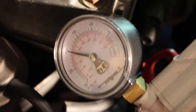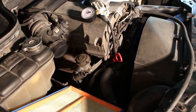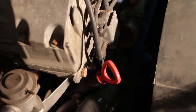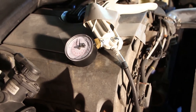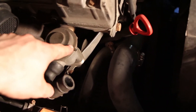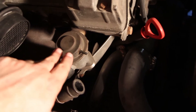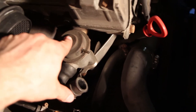As you can see, the secondary air injection check valve — or vacuum solenoid — is holding vacuum at 20 inches, which is about how much vacuum the engine would give. So that's good. The new test setup has the Mighty Vac plugged directly into the vacuum solenoid to see if it registers vacuum when the system activates. With the vacuum connection undone, we want to confirm no exhaust gases come out — if that's the case, the check valve is good and we can look at the pump next.